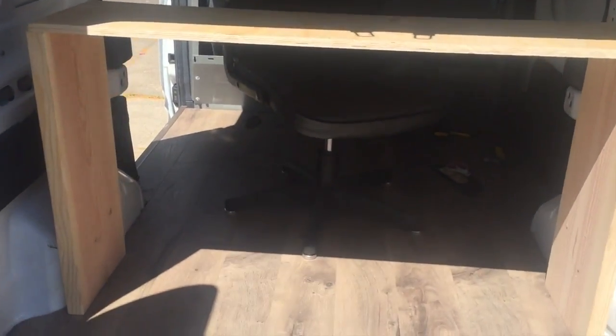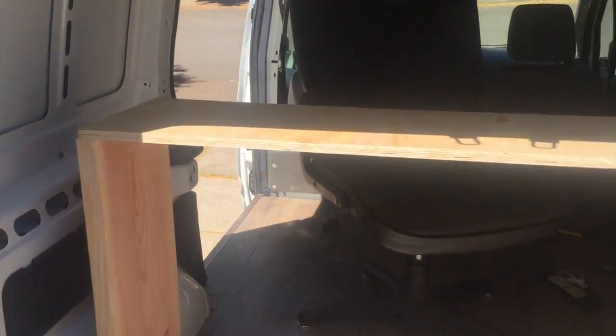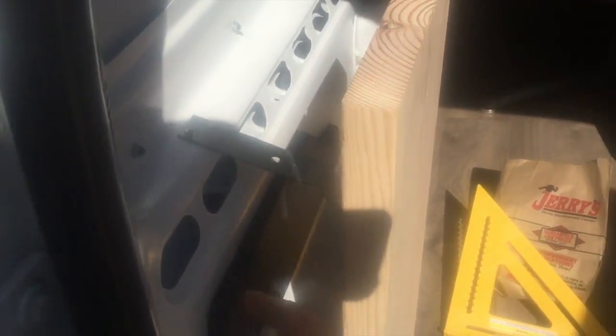Now I start putting pieces in my van without drilling them - this is called a mock-up, and it lets me double check my measurements. I put in this main support beam here. I have an L bracket that I custom fitted to connect to the wall of the van to give it additional support so it's really sturdy up top. Down here there's also a little L bracket, and I still need to do the same on the other side and put in the tabletop.